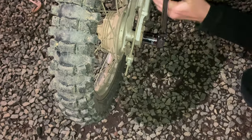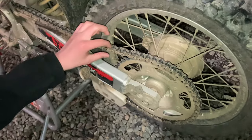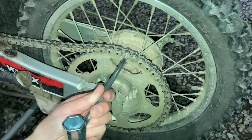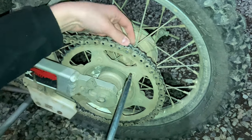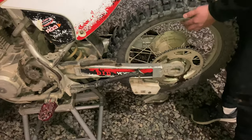This is a tricky part: since my stock chain doesn't have a master link that you just clip into place, I'm probably gonna have to get something metal and hard enough, then use a hammer, bang it, and individually pop this off, slide it out, and then put the new chain on. I just got the chain off.